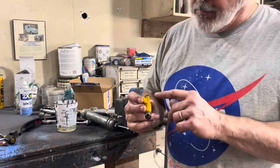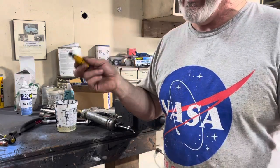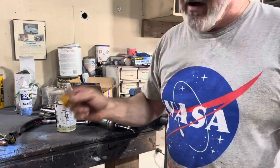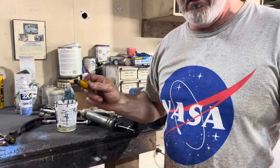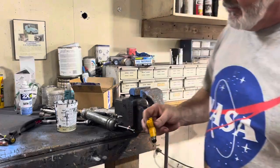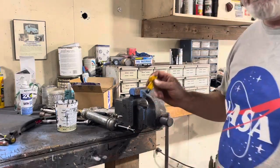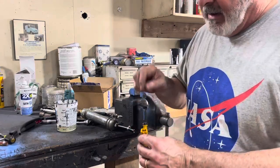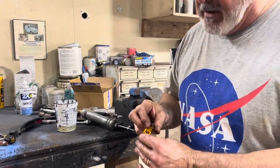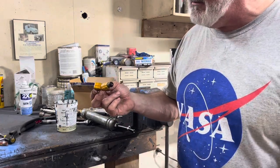So all we did was replace this O-ring, and I'll tell you what, out of the 8, 5 of them, the spray patterns did not look good until we ran that cleaner through. And one of them, as soon as I put the air pressure to it, started drip, drip, drip, drip. So there was a piece of junk caught in it. And I hit it extra good with that Seafoam, and then after a few times, the spray pattern cleared up and it sealed off.